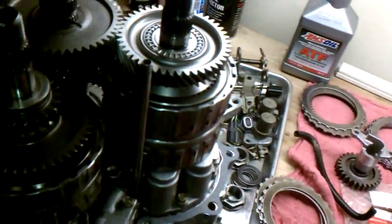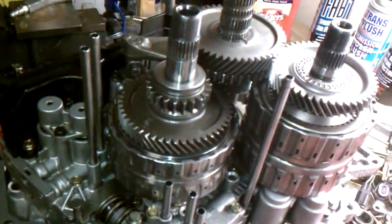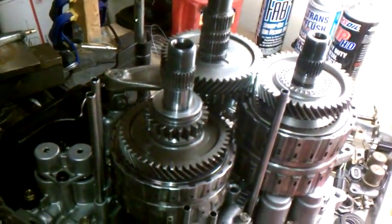Another thing I did was buy a replacement torque converter. Here's the filter off of it — these Hondas have one filter and you have to split the case to change it, so keep that in mind and do frequent oil changes. I probably only changed this thing about four or five times in 140,000 miles. This transmission was originally a rebuild — I bought the van secondhand in 2000, it's a '98, a two-year-old lease return. Right before it went out of warranty it started making noises; the dealer replaced the transmission with a remanufactured unit from HA Transmission.